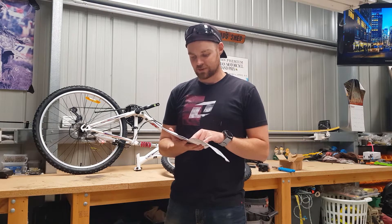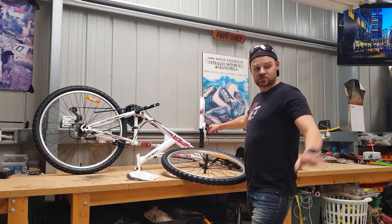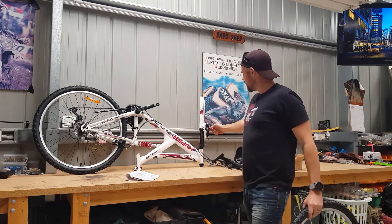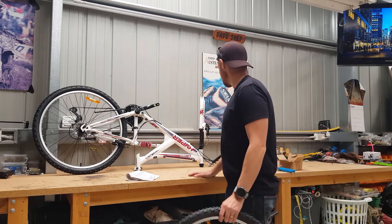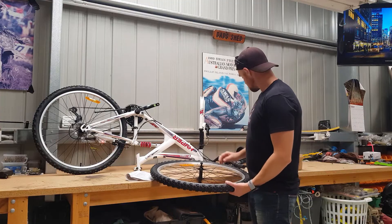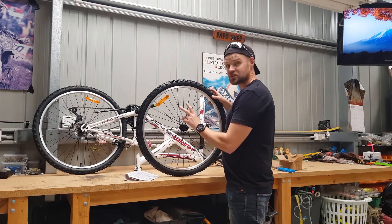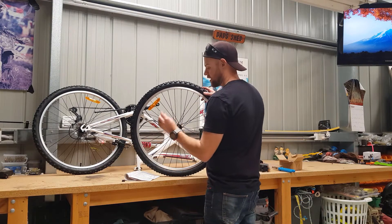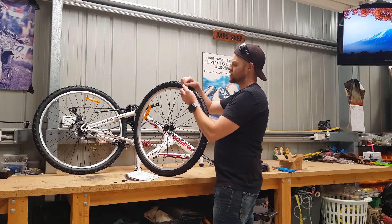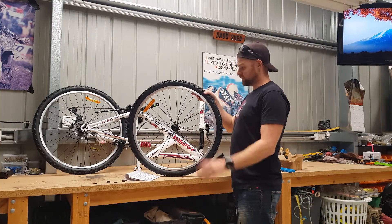Step two is the front wheel assembly. I'm going to show a few tricks I've learned in the past. The front brake is already installed from the factory straight out of the box, and the issue you're going to have is getting this wheel mounted on the forks and the tyre through those brake pads. The trick I've always used is to deflate the tyre — just take the cap off and deflate it at the valve — so you can squeeze the tyre through the brake pads. We're also going to take the nut and washer off both sides. You can struggle with this if you don't do those two things. It'll be a much easier job.